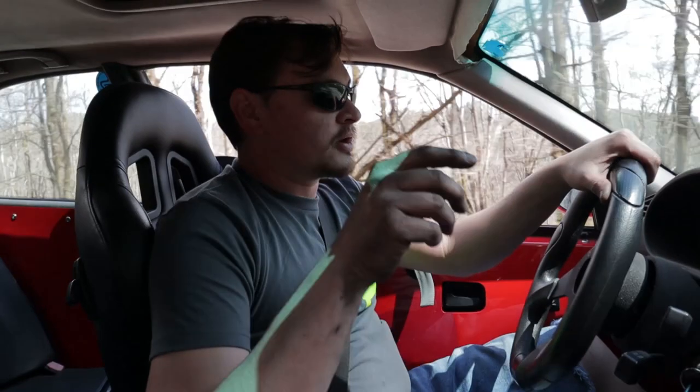Ha! You thought you got rid of me, huh? Well, turns out when I got to a point where I was gonna turn the camera around and get some footage of some mountains rolling by, one of my coolant hoses decided to bust. So if you have an E36, there is a coolant hose, I call it the octopus. It's right underneath the intake. It splits off in four or five different ways. And I've always hated that thing, and that's what broke.